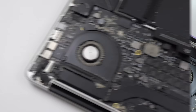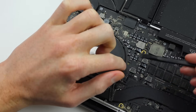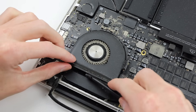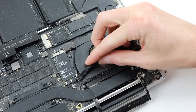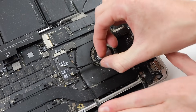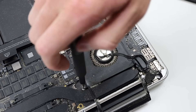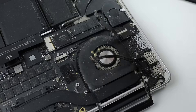The first thing I'm going to do is disconnect the battery to avoid any power running through the device while we're taking various bits out and cleaning it. The first thing I'm going to remove is the fan assembly. I'll start with the one on the left-hand side of the laptop. Removing three screws and a flex cable, we can take out that fan and it reveals a huge piece of dust underneath. I can then move across to the right-hand side of the laptop where I can disconnect the airport card, a couple of flex cables, and start unscrewing the fan and also the Wi-Fi card. This will give us access to the flex cable for that second fan, which we'll need to disconnect before we can entirely remove the fan assembly.